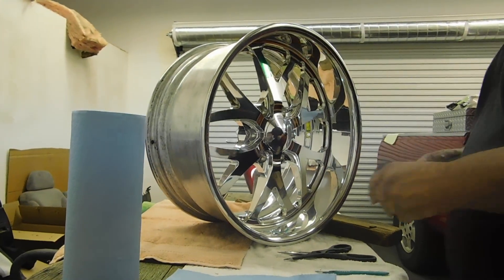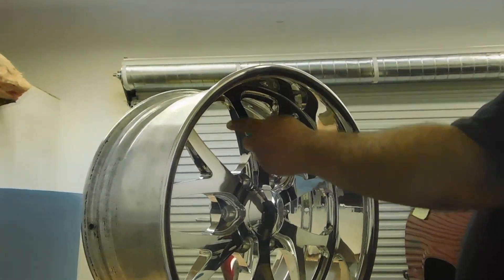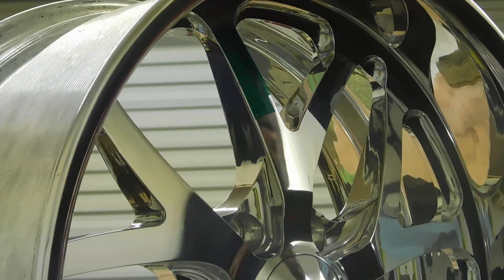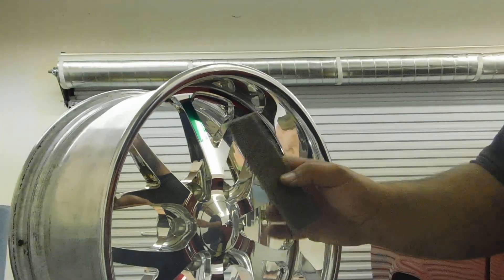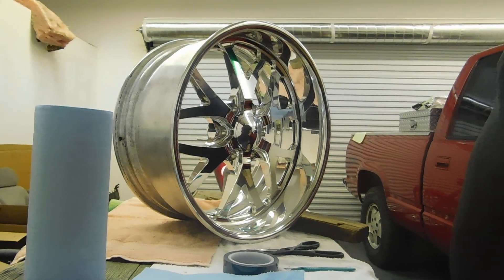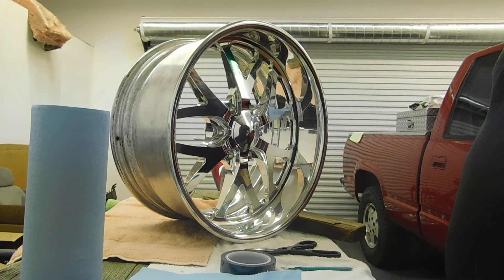One tip I forgot to give you: once you have masked all the area, if you're going to leave it polished inside the spokes, you're going to want to sand any areas in there. Because usually they blast with powder coating, but it's very risky to blast a billet rim. I found that sanding with a coarse brown Scotch-Brite pad — I'll leave a link in the description — once it's all masked, I'll scuff and dry-sand anything that's going to have powder on it. Once you're done sanding, check your edges again, make sure nothing curled up, re-tape anything you have to, and take them straight to your powder coater. Pick your color, have them spray them.